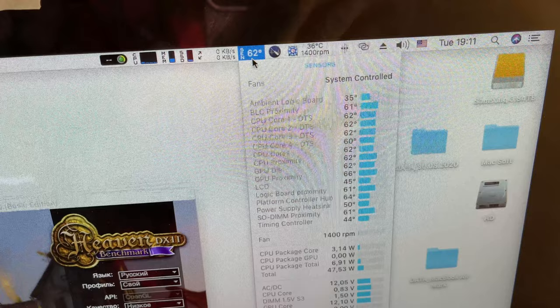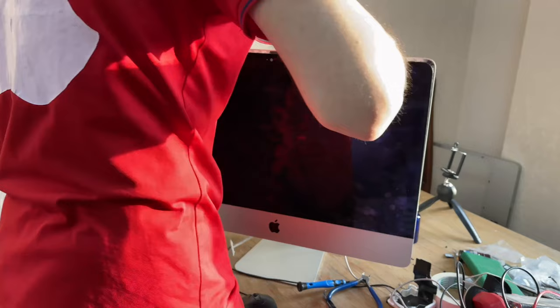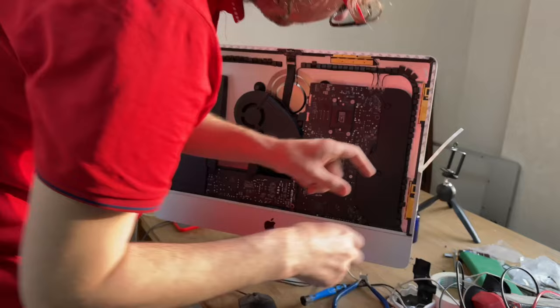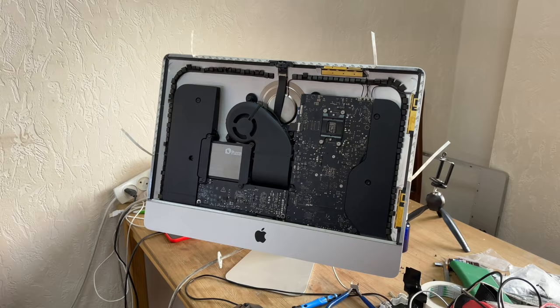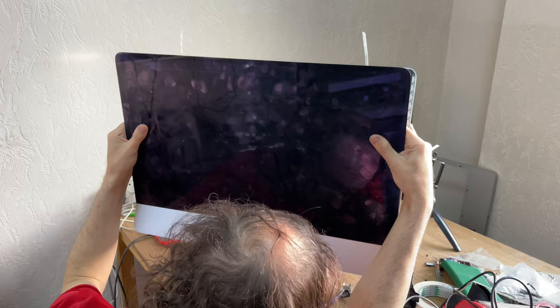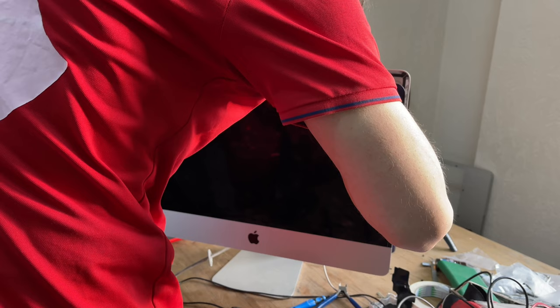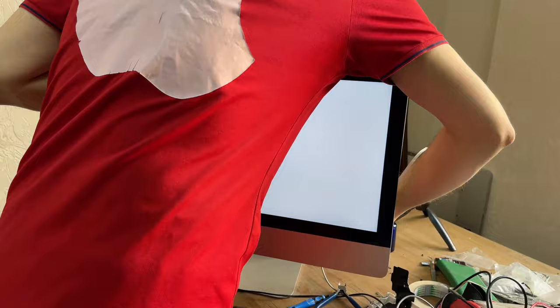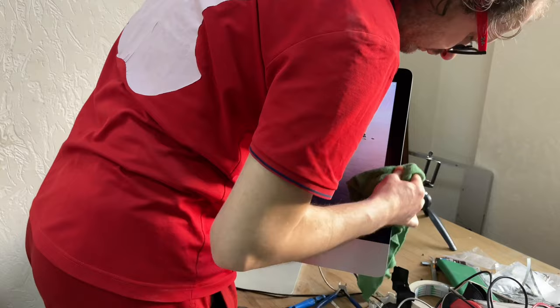Next, we go to the final display installation that powers the iMac. Connect the cable, connect the power, and turn on the iMac. You will need to place the display exactly around the perimeter and glue the lower part immediately, then make sure that the display works. Clean the camera from dust and seal it. You need to walk throughout the perimeter with a thumb so that the display is well glued to the body. That's all. Thank you for watching.